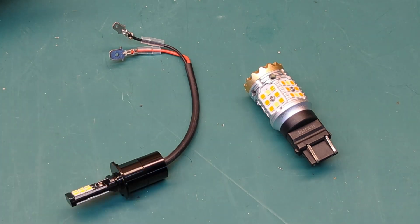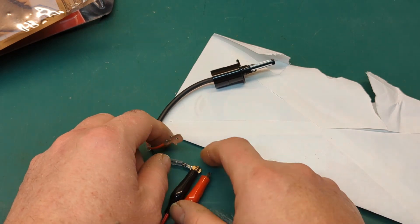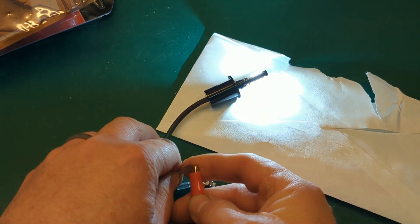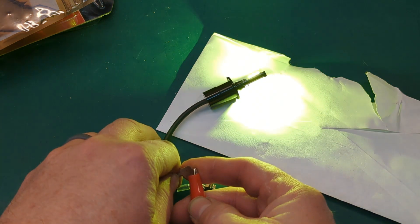They're typically used as fog lights because you can very quickly change between a bright white light and a yellow light. Now this particular bulb is an H3 style automobile bulb and you just hook it up and use it as you would any other H3 bulb. When you first power it up, it's going to be a default color — typically white — and when you turn that switch on and off relatively quickly, it'll change colors into a yellow light.